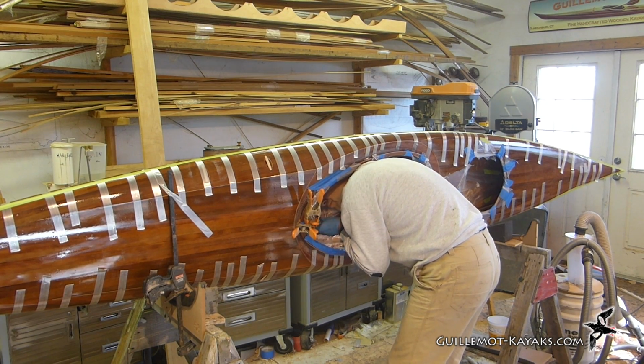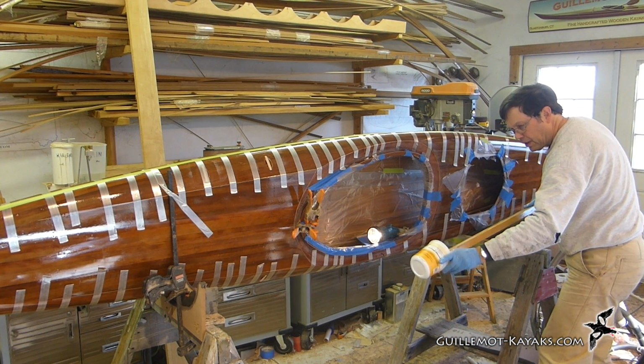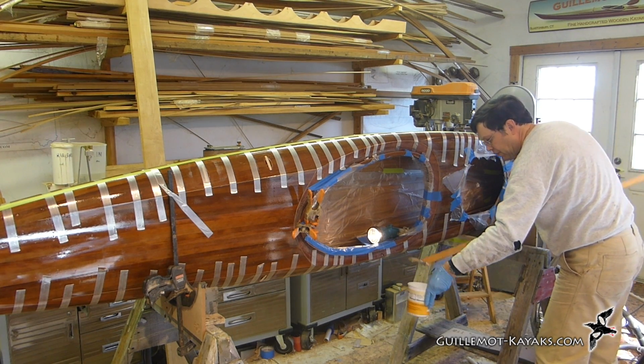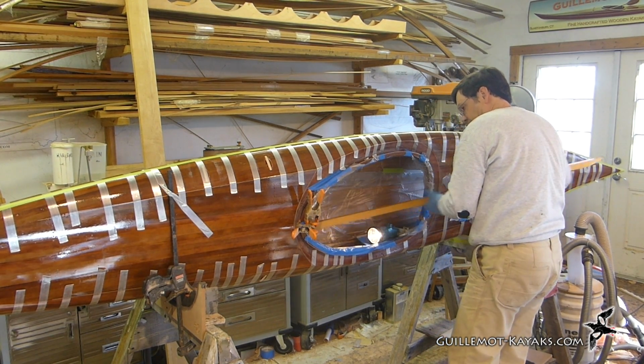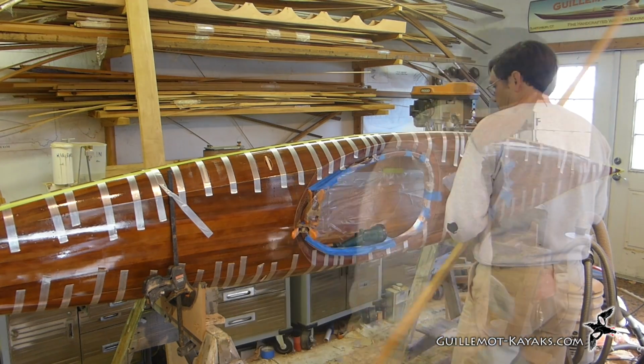This time I checked there were no snags before rolling out the tape. With the tape properly down in the bow, I now want to smooth it out and make sure it's well stuck down by brushing it with a bit more epoxy resin. Now to do the other end. Hopefully it'll go a little bit more smoothly this time.